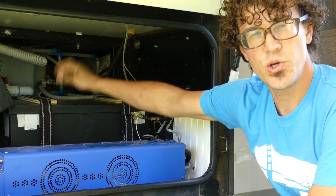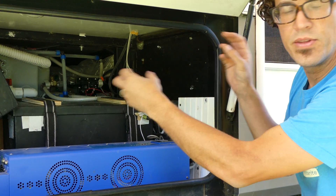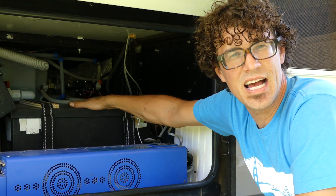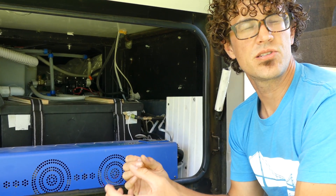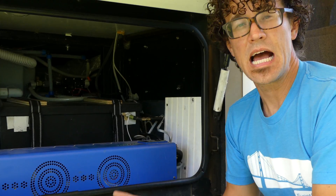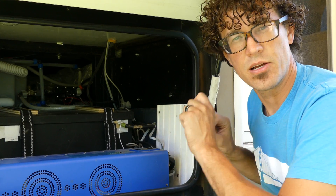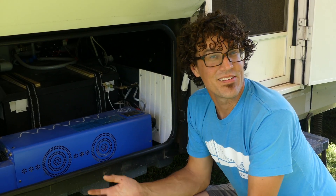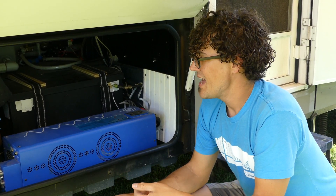This is our battery box. We've got two of our six volt batteries in there. The other two are under the stairs. They have wires going in between the two to connect the two pairs. One downside of lead acid batteries is that they really off-gas a lot when they're charging. They have to be really well sealed so that that gas doesn't leak into your RV, because it rises — it's hydrogen gas. So we have it set up so that there's venting in that box that goes outside. The big pro of lead acid batteries is that they're cheap — they're the cheapest ones out there. So that's pretty much probably the only pro. The cons are the off-gassing and the weight.